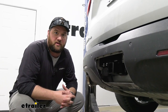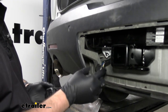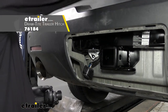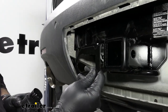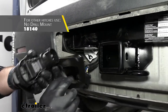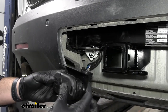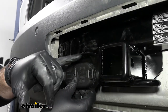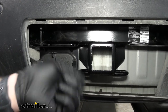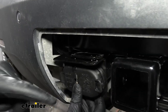With that being said, let's go ahead and show you how to get it in place. To get it installed, the hitch that we have on our Traverse does have a bracket — it's the Draw-Tite 2-inch hitch receiver. We kind of lined it up; the holes do line up, but the way that we're mounting it so that we can get this panel back on, we're going to flip it around, take our plug, clip it into place, and we're going to slide it over as far as we can to get it away from the safety chain loop so that we can still slide a chain loop in there and line up this hole with the second hole on our tab.